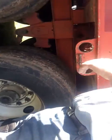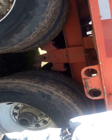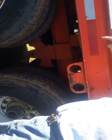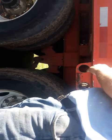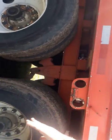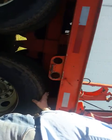Now this, you have a drag link right here. You want to make sure it's properly attached. No missing or broken bolts, no visual defects. Now 9 out of 10 times, if you get the whole trailer and you mention everything up to this point, they're going to tell you to skip this axle. If they don't, that means you missed something.